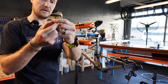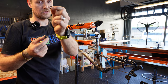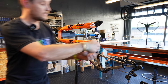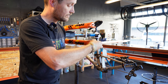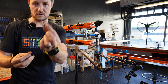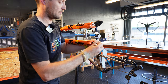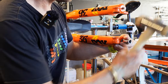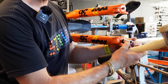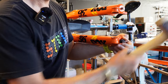Once the foot nut is off, it should bring with it a little plastic crush washer. These are single use — throw them away but make sure you have a replacement, which should come in the kit. You'll notice a little needle sticking out the bottom; using a deep socket protects that needle when you knock the shaft back into the fork. You can see it's now loose.